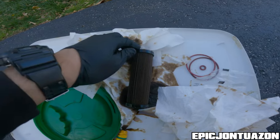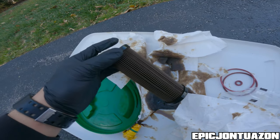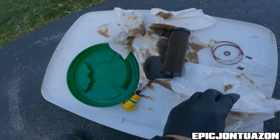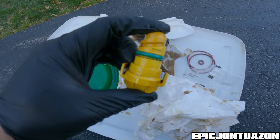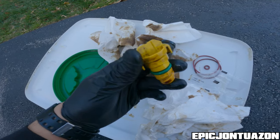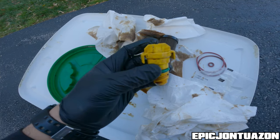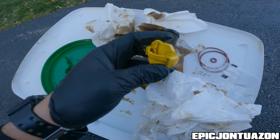Oil is still draining a little bit, but let's take a look at this filter. Pretty dirty for how many miles were on it — I have roughly 5,000 miles on the filter. Definitely for a new engine, I guess this is par for the course, but I'm glad I changed it. I'm probably going to end up changing them at 5,000 or 3,000 mile intervals. And while we're at it, let's take a look at this drain plug — we're going to be replacing it with the Ronin drain plug. Twisting this thing was pretty difficult, so if you're doing this for the first time, don't be hesitant to use flathead pliers. Just make sure you have even pressure and don't torque it — it'll come out.